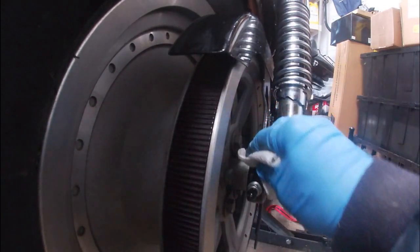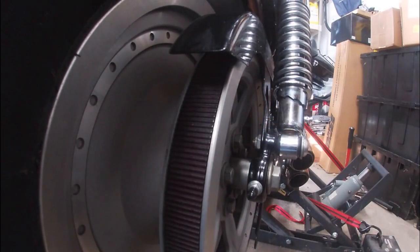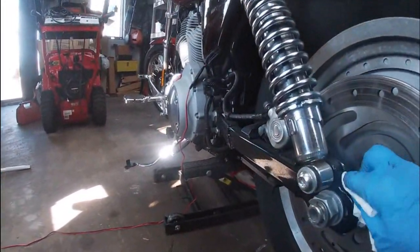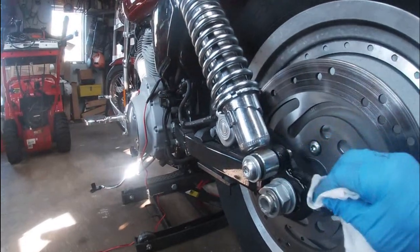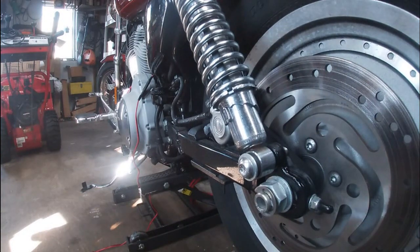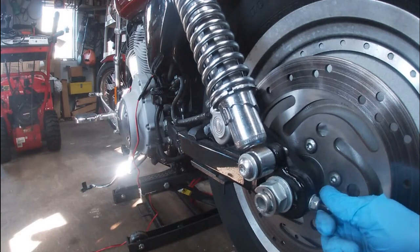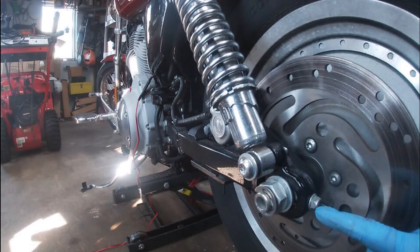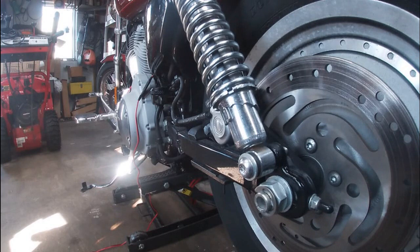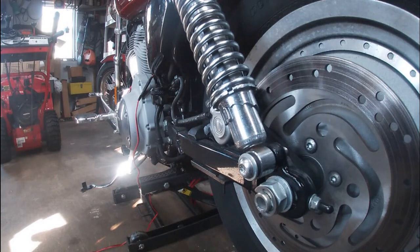You'll see why, if you've never done this before, why we do this cleaning and marking. Make sure this is good and dry. Basically what you're going to do is take some silver paint, mark the swing arm, mark the nut. This cap will come off, and once that cap comes off we're going to back off the adjuster nut three full turns — both sides will be marked, nut and swing arm, because right now I know my belt is in perfect alignment.